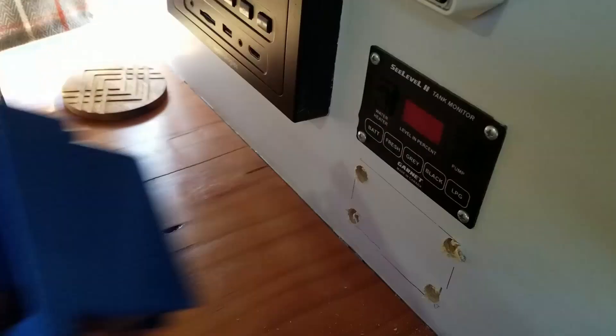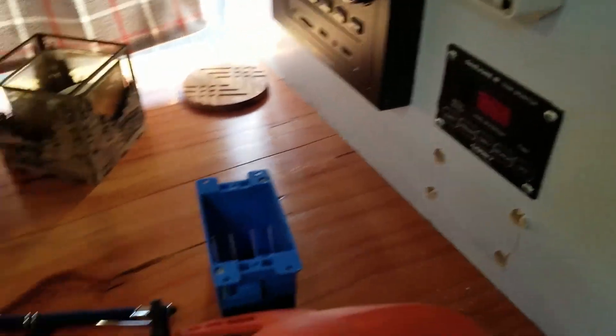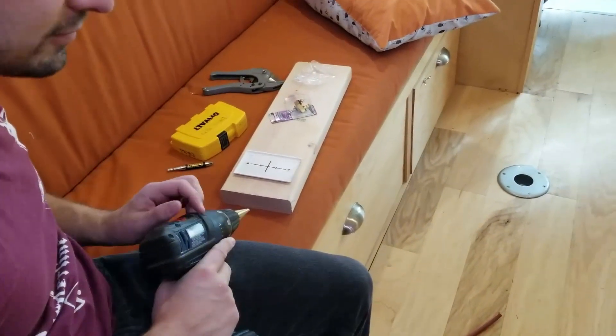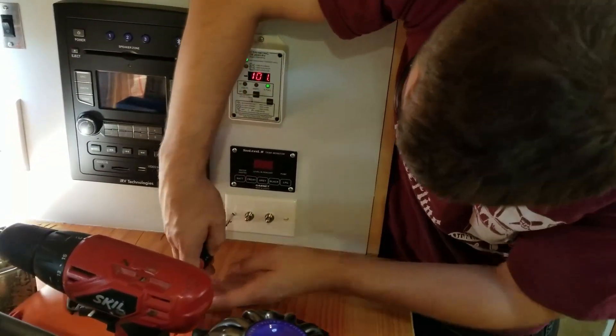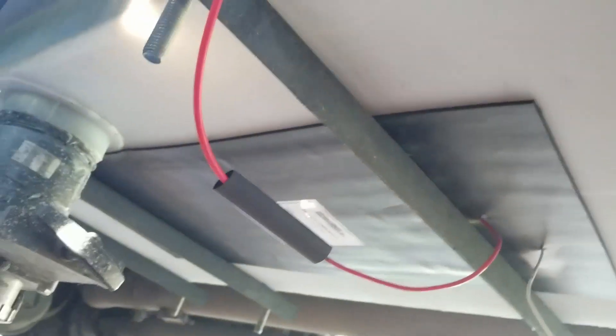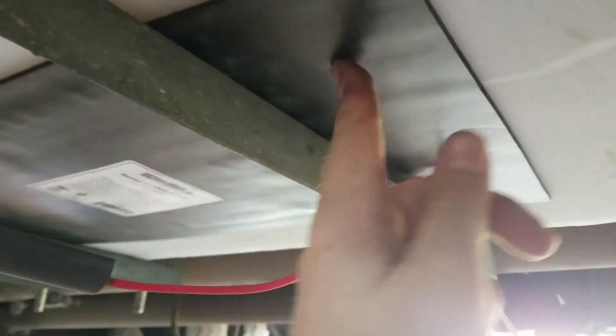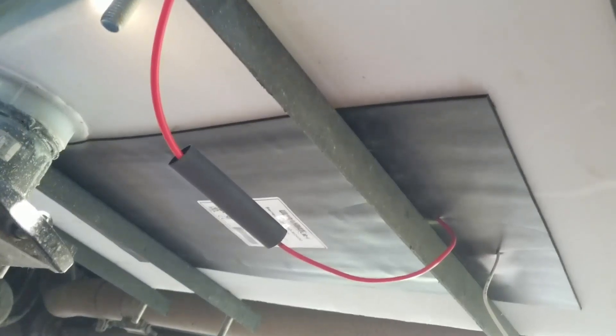So this is another day. Eric and I are working on installing the switch for the heaters. There are going to be two switches right here, but first I've got to put a junction box in. I've cut some holes at the corners and I'm going to cut out that shape and pop in the junction box. Eric is working on the switch faceplate, and then we wire it up. I'm under the bus wiring the last bits here — got to connect the heaters to the switch. This goes to the switch and this one goes to the batteries. After this, we just have to shrink wrap the connections and put a fuse on, and it is ready to go.